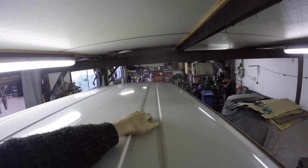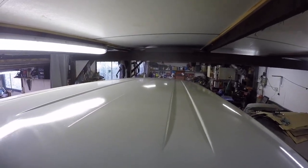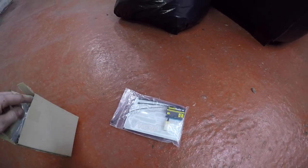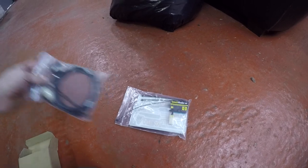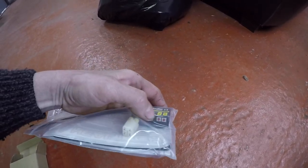I'll put one panel on this side — I've got some foam tape coming to fill that ridge up — and I've got some special caravan adhesive. I'll put one over that ridge once it's filled, leaving the middle ridge free, then the other panel over the next ridge. I'll have to drill through the roof front and back in four places for the wires, then seal it with Sikaflex — not happy about drilling through the roof but it's got to be done.